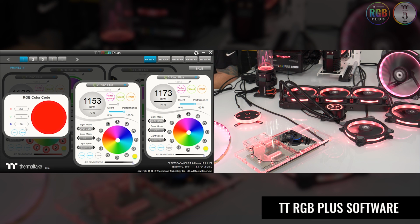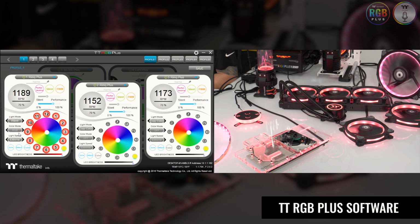So if I go into color and I take blue and set this to 0 and click OK, and then I'll go and click save, you'll notice that what's going to happen is it's going to all sync back up to the true red. So everything is the exact same color red, because I know there are people out there that want to have something very specific, or they want to make sure that everything is the same across the board. And that's what the TT RGB PLUS software has to offer for you guys.